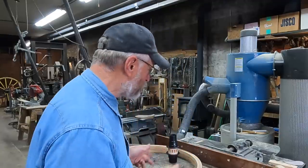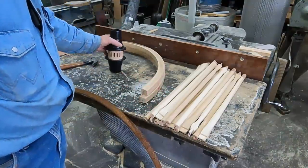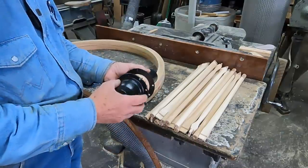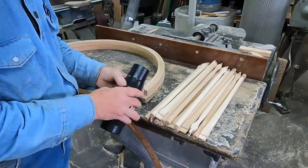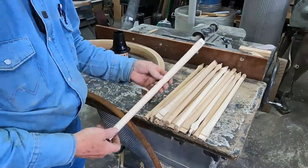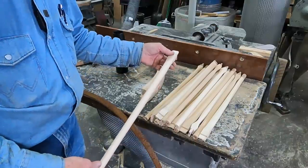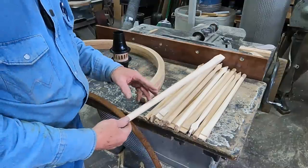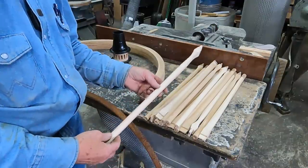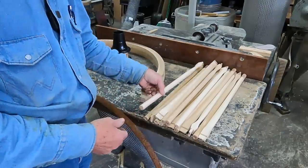But I have some parts here that I have assembled to build this wheel. I have this hub here. It's a new core. I have somewhere in the past sandblasted and cleaned up the flanges, so I'm going to use this for the hub. I have 16 spokes here, and they're a Sarven spoke, but they're brand new, and she would like this to have that weathered look. So I'm going to take these, I'm going to cut them off to about 16 inches. That'll still be a little longer than I need. And I'm going to run them through the sandblaster to give them a little more of a rough effect instead of this nice smooth finished effect.